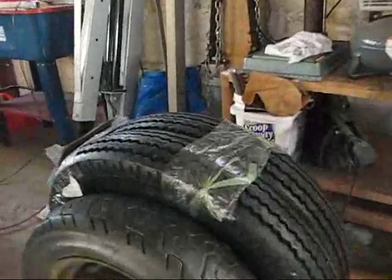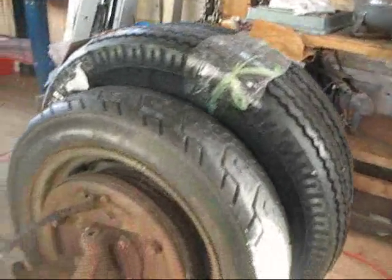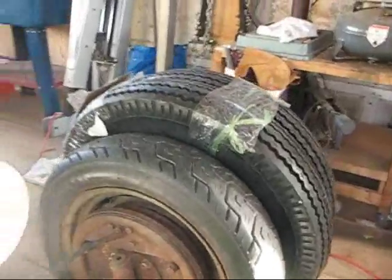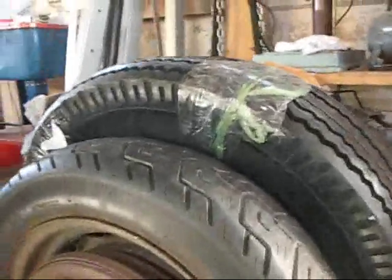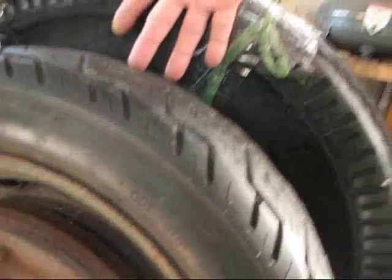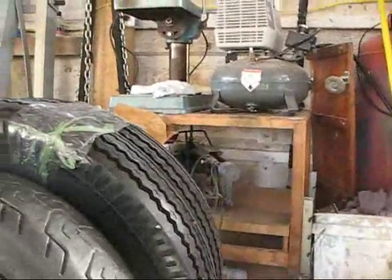This is wicked exciting — my tires came. Somebody pointed out that these are Harley-Davidson motorcycle tires, and they're exactly right. I wanted the tires to be a good bit taller, and they are. This is going to get the front end of the car up a little bit, which I need because right now the car is so close to the ground that the steering box would drag if I went over much of it.